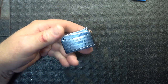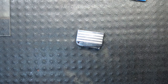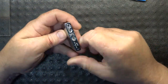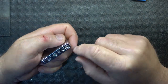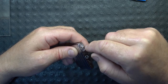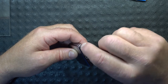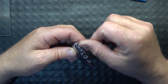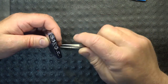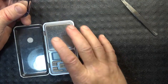All right, you know that I ran out of video space when I was putting in that filler valve on this Belflame pipe lighter, so I'll splice this video together. You'll see in the earlier video how I installed this, but after I put everything back together and put gas in it, I had a leak around this flame adjustment valve. So I ended up taking it apart and putting an O-ring around this. I set my internal adjustments for high flame, then when I put this down in, I can adjust it for a smaller flame. I had to take a pair of tweezers like this to get in here and adjust this, and it is tight, but it will adjust accordingly the way it's needed.